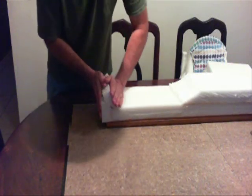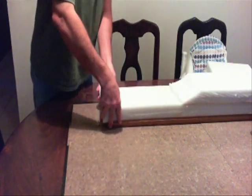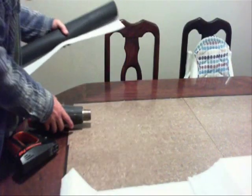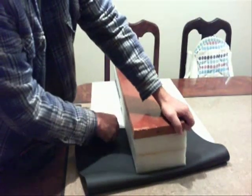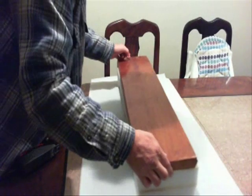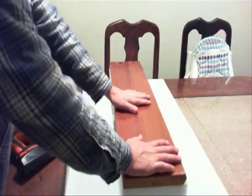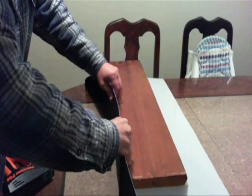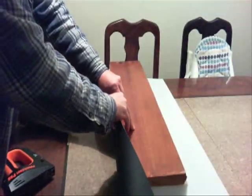I got the last little bit glued on and here's the final shape I'm going with. I bought this vinyl especially for motorcycle seats — it's supposed to be able to withstand the sun and the wear and tear of sitting on it. I'm also using a heat gun, which helps to loosen it up as you stretch it, especially around the areas where I have the different levels.